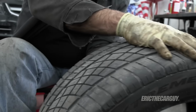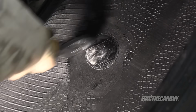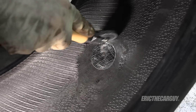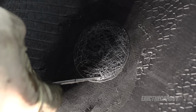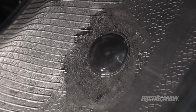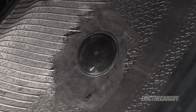flip it back over. I can take my wheel, run it down, flush. It says to go from the inside out, but I just crisscross a bunch of times, trying to make sure that the edge is sealed. This is a coating. Just trying to catch an end of it. And that comes off, and the finishing touch, we have a sealer to go over top of that.